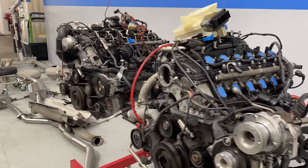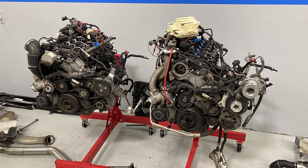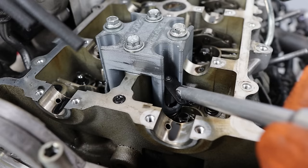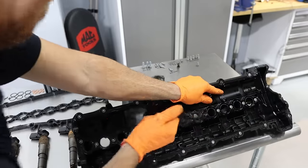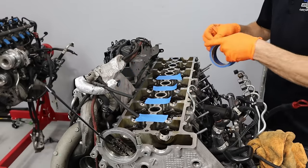Now that I've got both engines out, I'm going to start with the good engine. I'm going to pull the valve cover, pull the camshafts, and update the valve springs because once you put bigger turbos, dual fuel pumps, and start adding horsepower, it's really common for these engines to float the valve. I want to make sure I have upgraded valve springs as a preventative measure. While I've got the camshafts out, I'm taking advantage of this opportunity to clean all the intake ports and valves. There's a lot of carbon buildup very common on direct injection engines. We modified a special tool from an M57 intake manifold to perform intake valve cleaning using walnut shell media. The blasting wand is inserted into the tool, the shop vac is connected, and while the walnut shell blasts away the carbon, the vacuum simultaneously removes all the carbon and shell media, leaving a perfectly cleaned intake port and valve. This is so satisfying — look how clean those are.